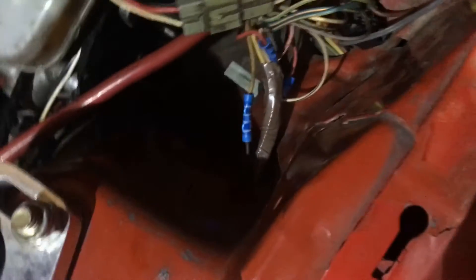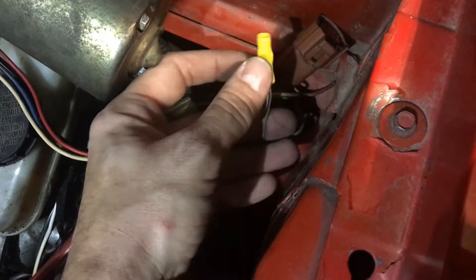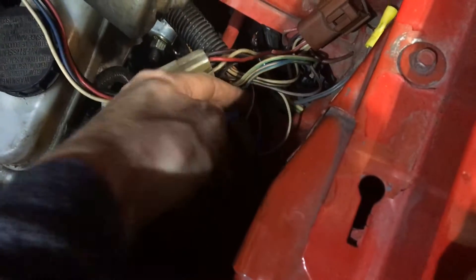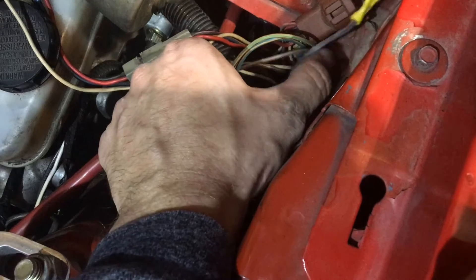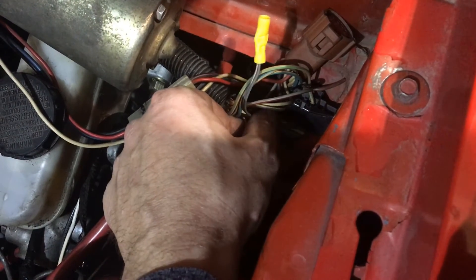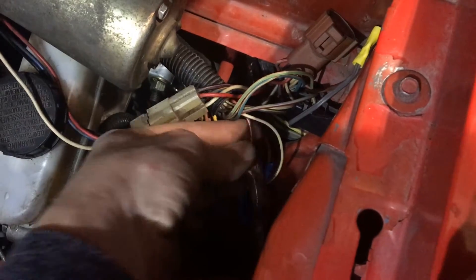What I'm trying to do here is get this wire, which goes to my fan relay, tied into the wire that I just identified - that guy right there. One side of it is going to be the resistance coming back from the temp sensor and the other side is going to be my ground for reference. So I'm going to tie into this wire that comes from my temp sensor over here that I just identified.